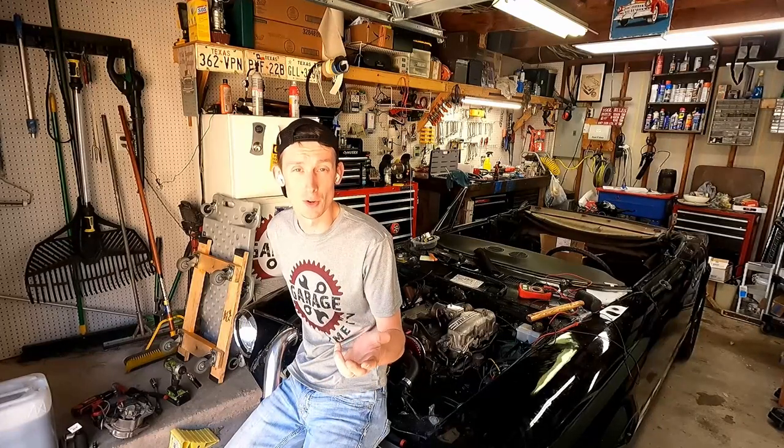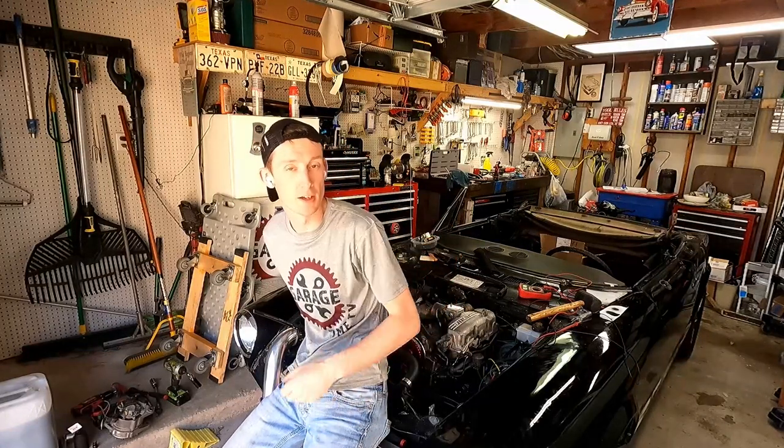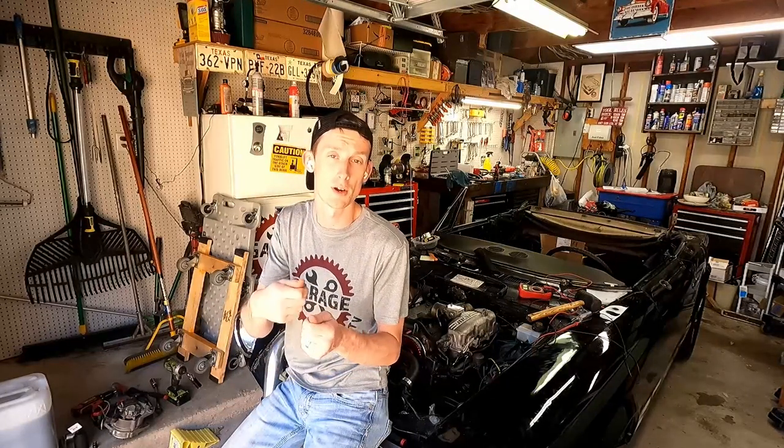That's going to be it for this episode. It's actually relatively simple to install a cooling system in a vintage Fiat — new radiator, fan, all new rubber hoses, the thermostat, and bleeding the system with that little tee at the top of the heater hose connector. You'll need to bleed it again once the car is running. I also turned the water pump by hand so air trapped in the pump fins could escape through the top. Thanks for watching — make sure to like, subscribe, and comment. Until next time!